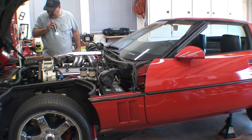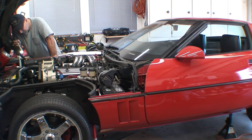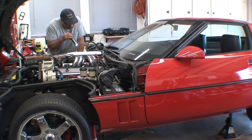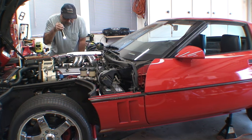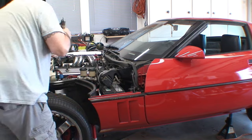Right now it's at 40 psi and it seems to be running pretty good at that pressure. Probably because I have colder plugs in there — I need to run colder plugs for the supercharger. So it makes sense that the additional fuel and the colder plugs have it running pretty good. That's it for now.